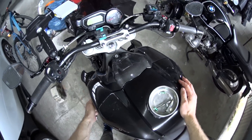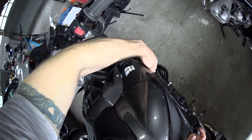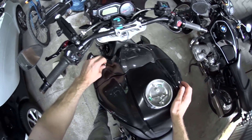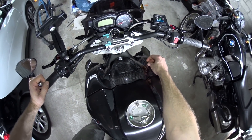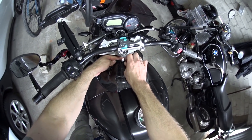In the almost two years that I've had this bike I found it to run very smoothly, but just recently I've noticed a little bit of an extra buzz creeping in. Now whereas this buzz could be the fault of dodgy fuel or worn parts, old age, or maybe even the dreaded valve clearance which is just about due — it could also potentially be down to the throttle bodies being out of sync with each other.